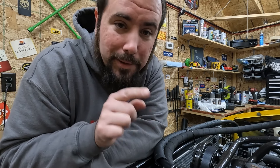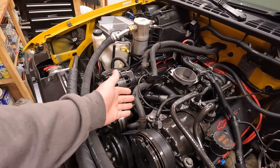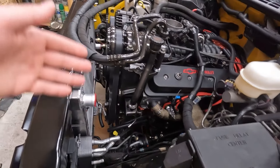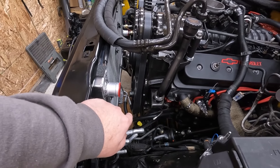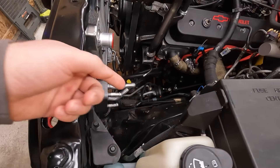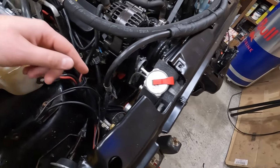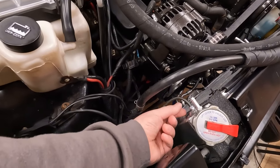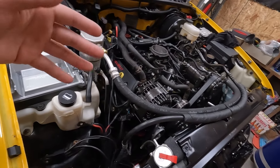With the body dropped, I've been doing a lot of plumbing. I've been working on everything in here — coolant lines, heater lines, coolant lines going to an oil cooler, lines from the oil cooler, lines to the remote oil filter, power steering lines, power steering cooler lines, transmission lines, and transmission cooler lines. I'm also going to have a remote transmission cooler up here with a thermostat, and I had to come up with an adapter for the fittings on this aftermarket radiator.